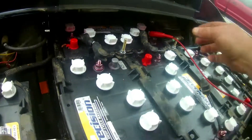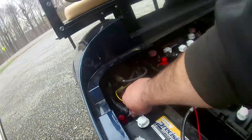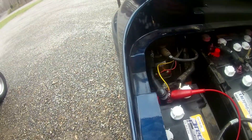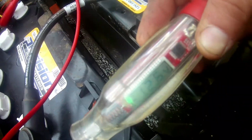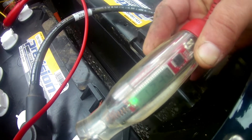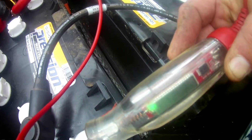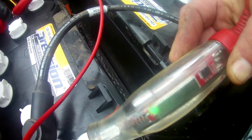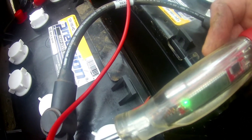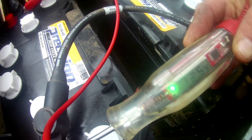They're all super close together. I'm going to take a little short ride here and see how bad they drop — shouldn't be bad at all. Look at that. It doesn't even drop past 12 volts at all. And that's exactly what you're looking for when you're doing a battery job: to determine how far the pack is actually dropping from battery to battery.